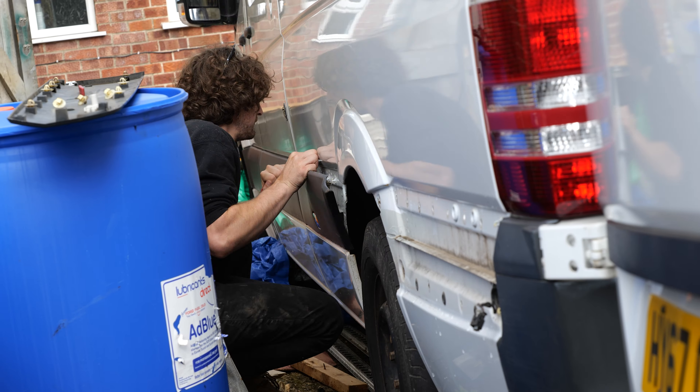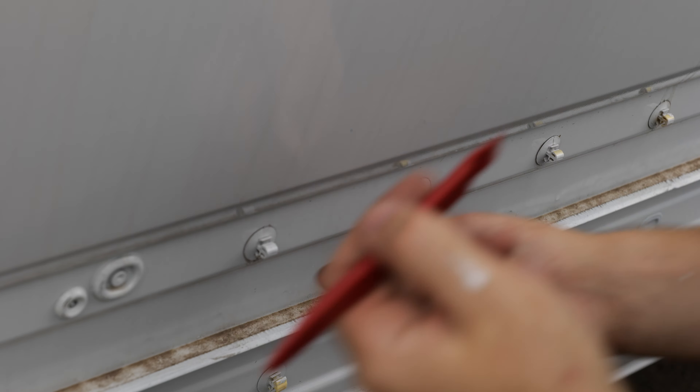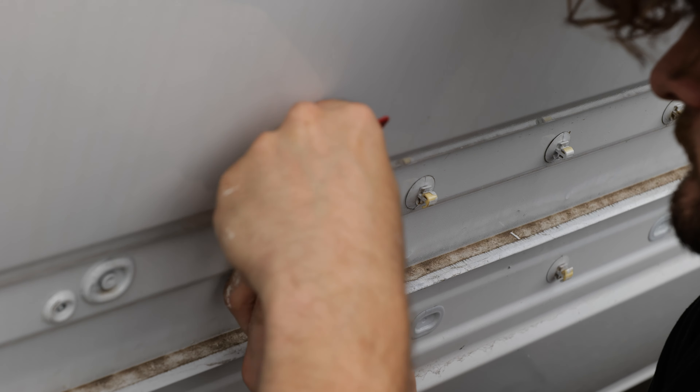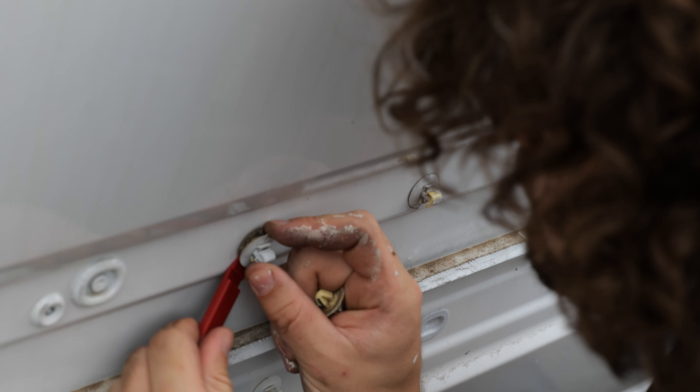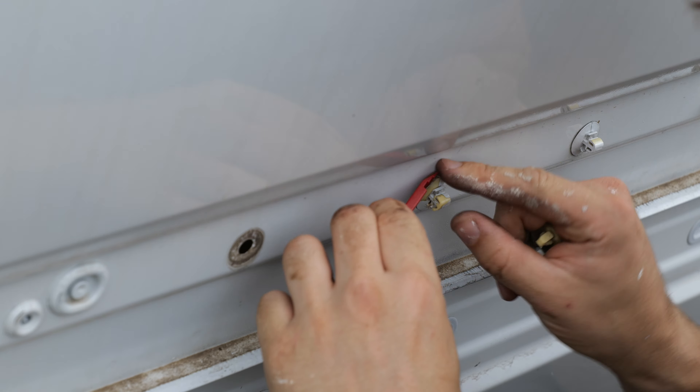As I was a one-man crew, I found that if I popped the trim off using the crowbar trim tool, that would often leave the clips themselves behind. But then I could always come back with the trim tool, get behind them, squish the little pinchy thing, and they would come off really easily and without being damaged.